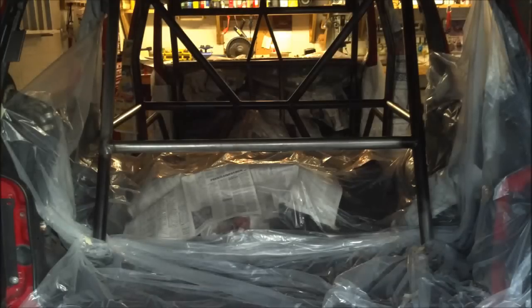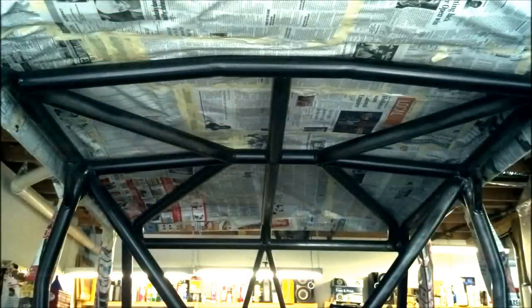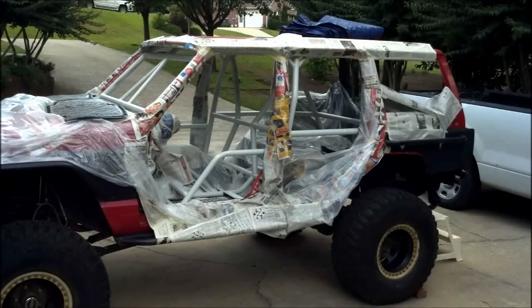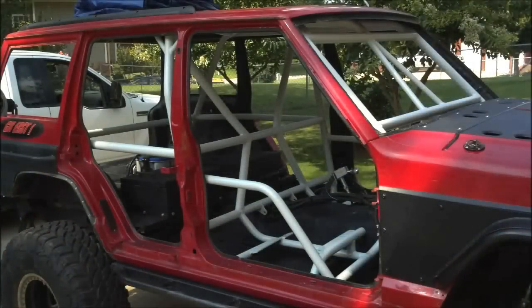This is a one and three-quarter inch, 120-wall MIG-welded cage. We used about 100 feet of length on that, give or take, and it was done in a relatively short period of time. I painted it with a color referred to as Ford Gray — it's not white, but it appears that way. It's great contrast to the black and red in the Jeep, but it is a pain to paint. If your interior is going to be black, you need to tape off everything you don't want to be white.